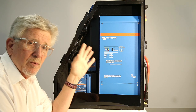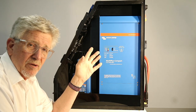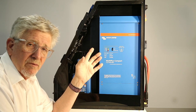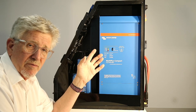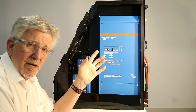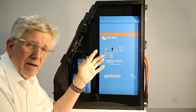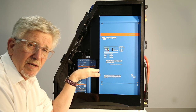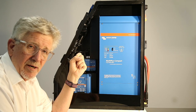This will take up 400 watts of solar on the roof. My rough rule of thumb is you need at least 200 watts to run a single fridge, 400 watts for double fridges — that gives you a long weekend, about three days, with no driving. But with the DC-to-DC as a backup, you can idle the car and that will replenish the power.